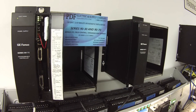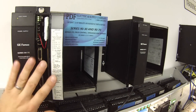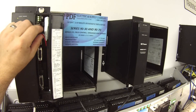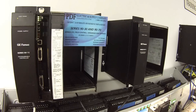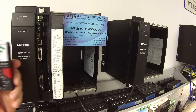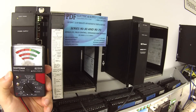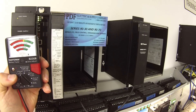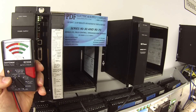Another way is to obviously leave the CPU up and running — don't shut it off with the battery disconnected. I can't stress that enough. You can also get a lithium battery tester. I have one here. If you can see at my thumb, it says lithium 3 volt — I've got that selected to test this battery.